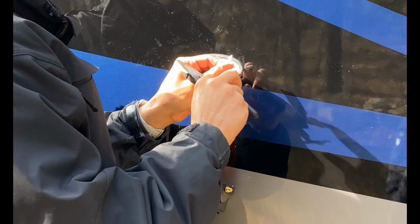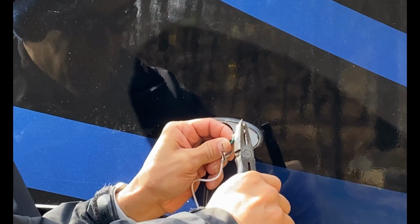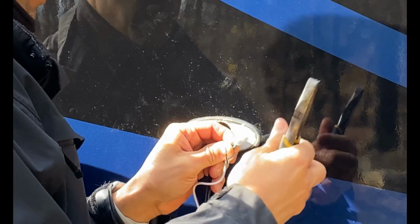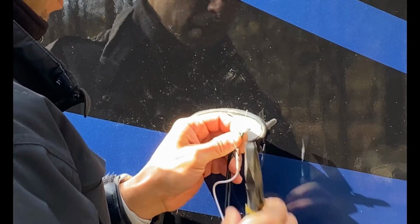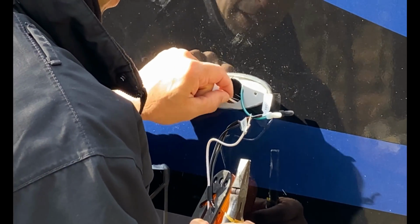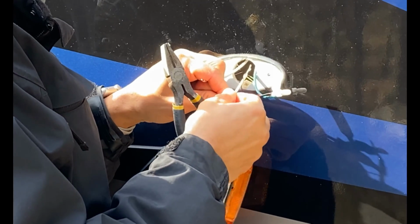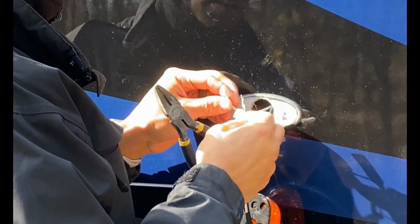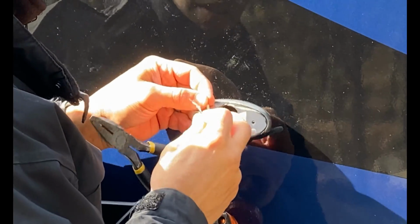And there's a little piece of metal inside this cap, okay? I'm gonna squeeze that with the pliers, squeeze it down. And what that's gonna do, it's gonna bind all those wires together, okay? So that's one side. We're gonna do the same exact thing on the other side, okay? Guys, you wanna make sure this wire doesn't run back into your wall, because that's gonna kinda suck. I'm hoping this works. All right, let's go here.